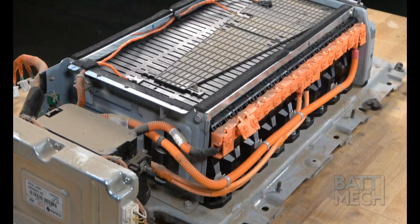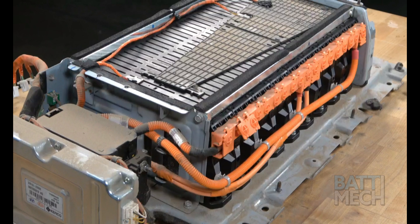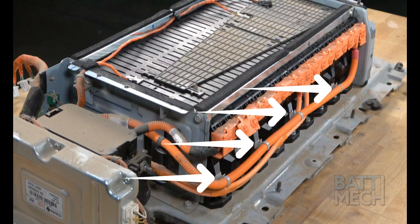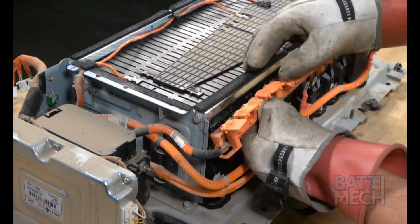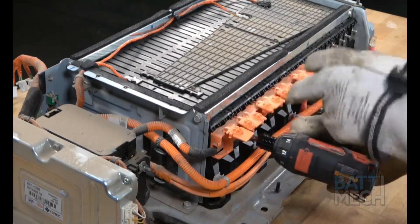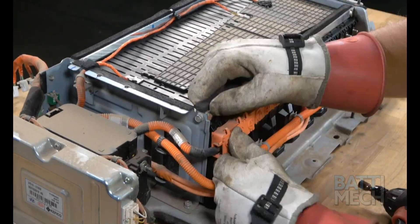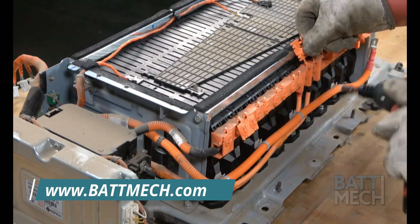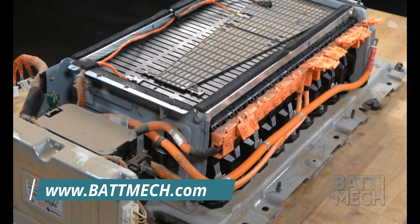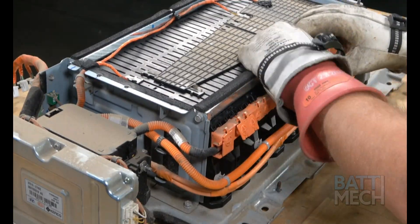Before continuing to the next step, be sure these four wire eyelets are positioned in the correct locations as shown before attaching the nuts. Also, be sure that you have clipped the wire harness back in and onto the battery modules as shown. After you've secured the wires to the bar with a zip tie, move to the other side of the battery pack and attach the wiring harness to the modules using the nuts. When attaching the orange wiring harness, it will re-energize the battery — be sure to have on the proper PPE. Once all of the nuts are on tight, go ahead and close all the wiring harness covers.